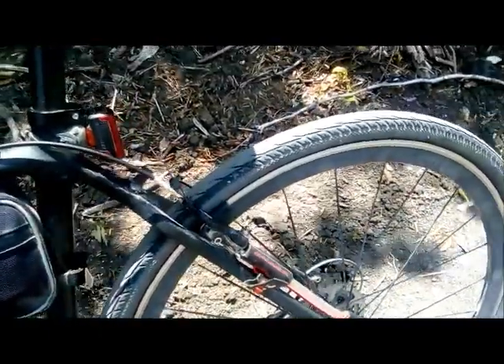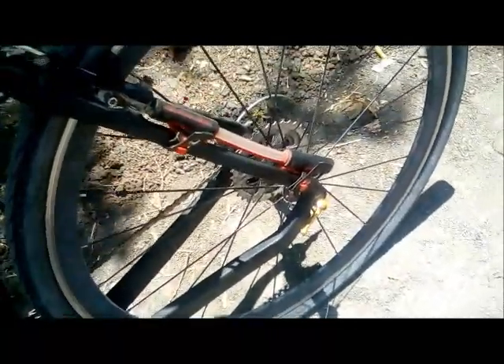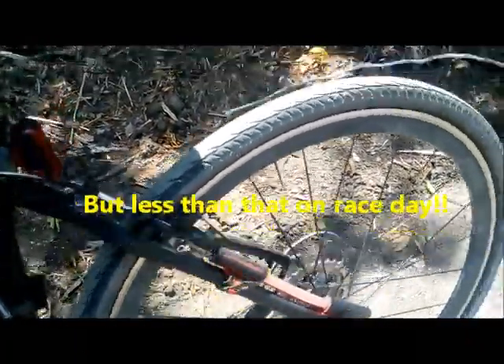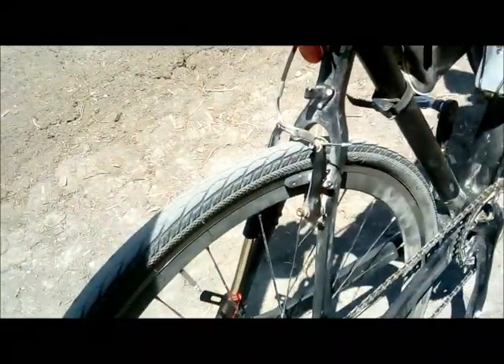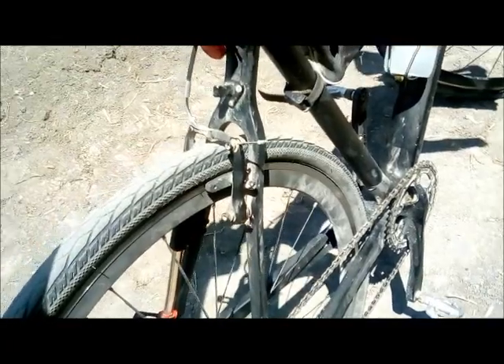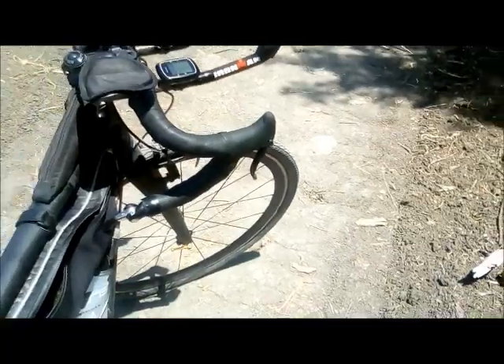has been that you don't have to air up the tires very much. I let these things go for three weeks to a month without putting air in them. I generally keep them between 60 and 70 pounds. The sealant works for micro pores and macro pores and seals them both up, so you just do not have to put air in your tires as much — not like every third day as you'd have to with unsealed tubes. That's another unanticipated benefit of having sealant in the tires.